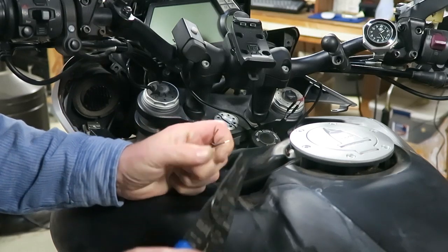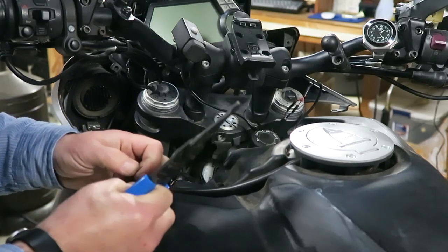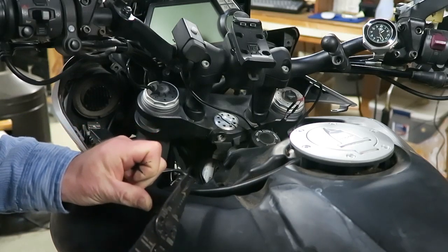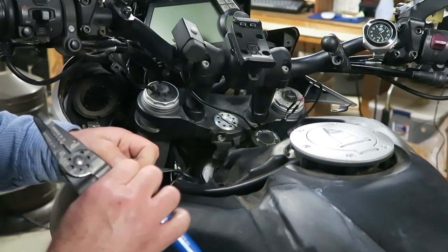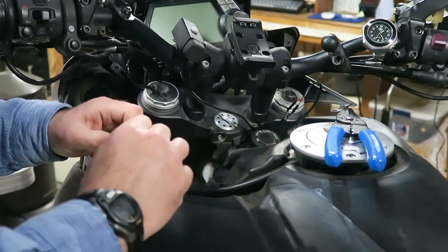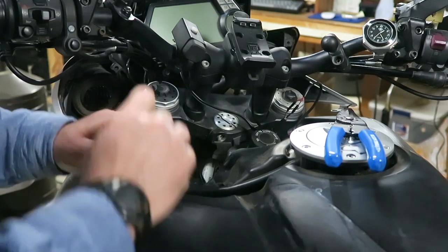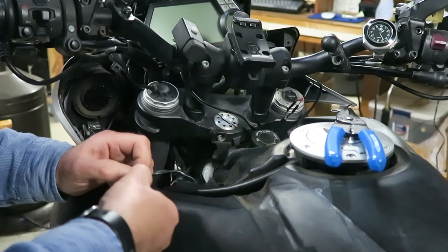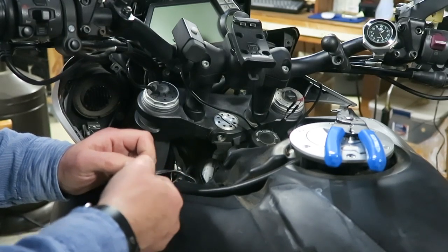This is a series circuit. This is DC power. The DC power comes into the one grip, goes through the resistive circuit for the heated grips, and then comes out of the heated grip, goes to the next heated grip on the input of that, and then the output goes back to the return of the battery. And that's how it heats up.